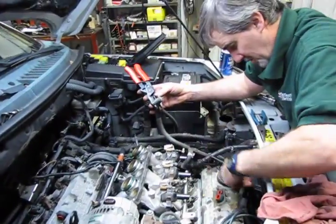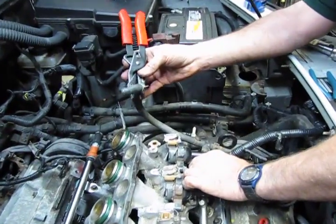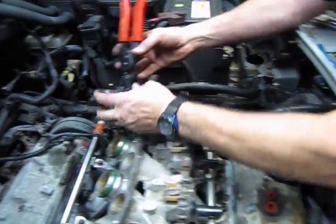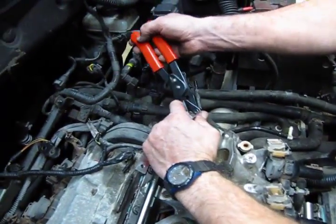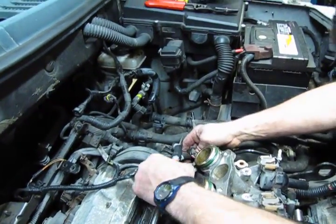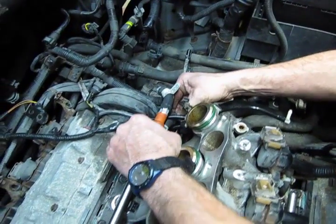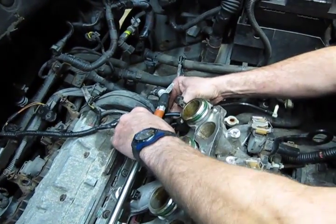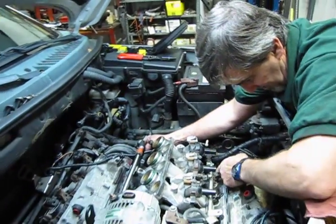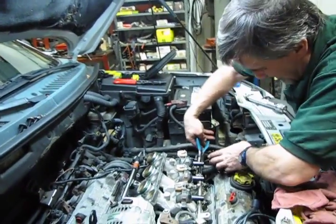Next we're going to put that coolant hose on that goes into both the manifolds. It goes up and over the harness. Push the front in, and I can unclamp it now. Sneak in underneath and push that down on the nipple there. Alright, then we just get a pair of pliers and slide the clamps down, making sure the clamps are in about the same position they were in when we took it apart. It'll give you your best seal.